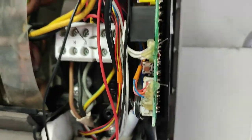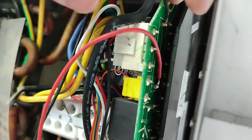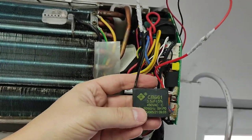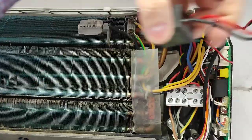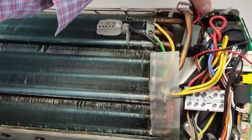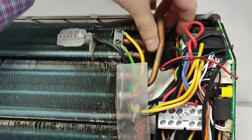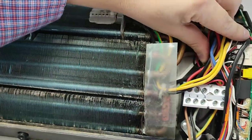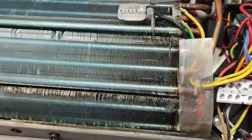Note that it should be a non-polarity one. You can buy this element for about $2 from RadioShack or some other radio stores. I will remove the connectors and pre-solder the wires of the capacitor. Here I will show you how I soldered the wires on the board — you can see how I attached the wires on the back of the capacitor. You don't have to worry about the polarity here. Now put the capacitor somewhere, being careful not to touch the piping inside the unit. After that I will put back the board and rearrange the wires carefully.